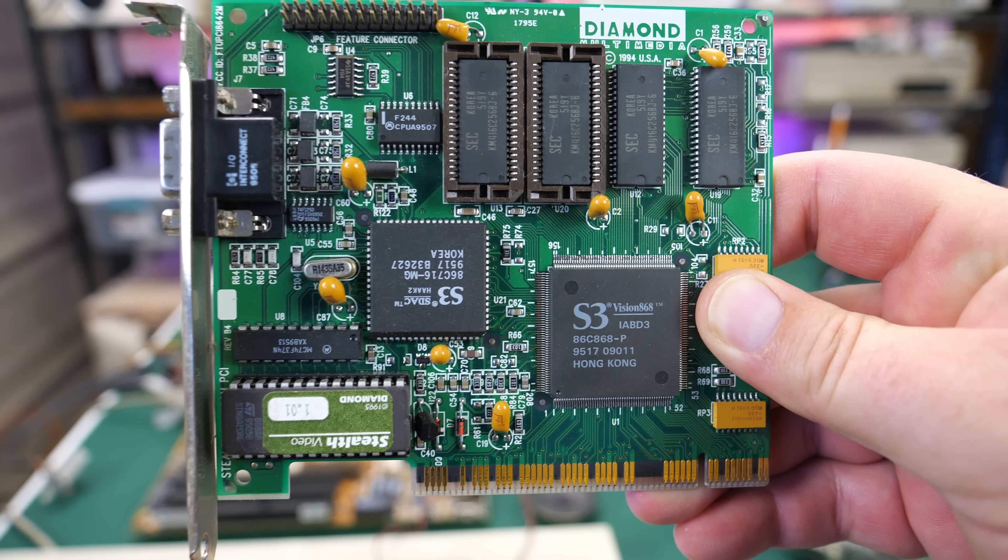In terms of a hard drive, it was included with this system — a lot of times people take these out even for older systems. I was glad to see this in here because if it's working, we might be able to see what this user was using this PC for. This is an 8.5 gigabyte Western Digital Caviar drive — very typical of the time. There's also a TEAC floppy drive, and an Access Tech CD-RW drive that supported 32-speed reading and 8 or 12-speed writing. CD burners were becoming more of a commodity at this point, so it was easy to add one after the fact.